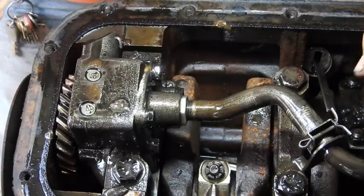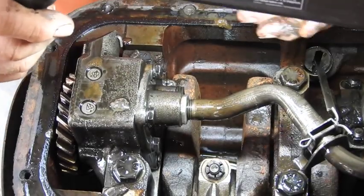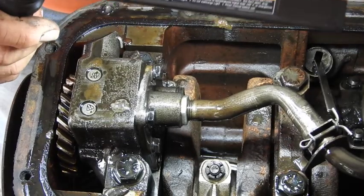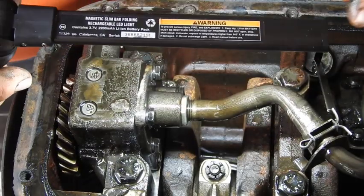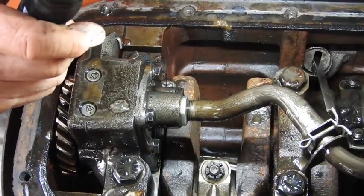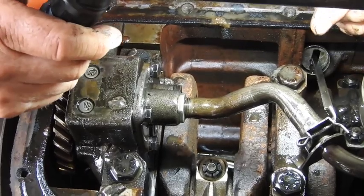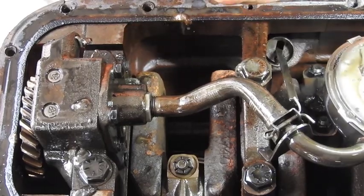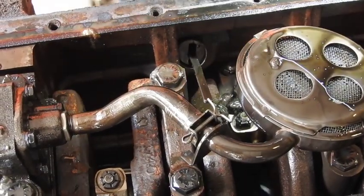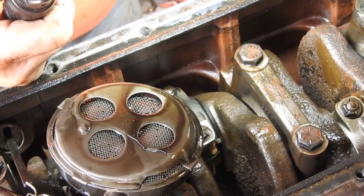So the next thing — the oil pump's got to come out. This is the oil pickup tube, and then the oil pump's over here. There's no rust in there. But we take all these bolts off right here — those are the main bearing bolts, and those are the ones that have to be labeled and put back in the orientation they came from. Number one has to go back in number one, right side goes to the right, two, three, four, all the way down. Once we get those off, we can try to get the rod caps off of whichever ones we can, and then we start going about the business of getting the crankshaft out. The rod caps all have to come off in order for the crankshaft to come out. Then we can beat on the pistons from the top side. You have to mark them and make sure you put the pieces back in the orientation that they came off — just like we did on the push rods.